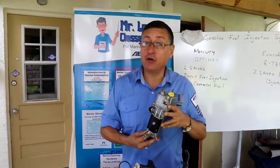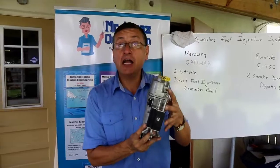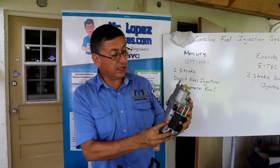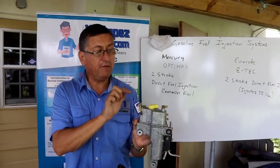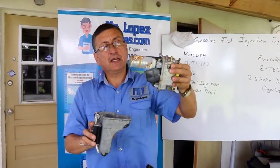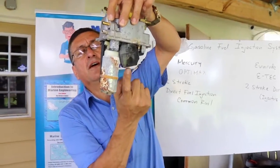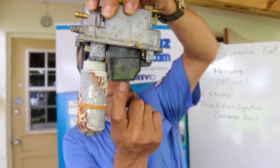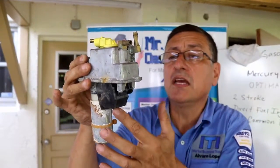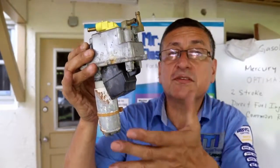Another important element that I recommend verifying is the high pressure pump for the previous engine. This is the high pressure pump where the fuel and the oil are mixed. The fuel enters here, fuel coming in, fuel return, and oil coming in, oil return. If you disassemble the pump, you find the float, exactly the same as the float in the carburetor. You have the needle, the base, and the float. If the fuel entering is contaminated, the needle is clogged, and for that reason the pump or the system works improperly.